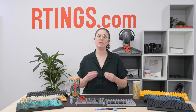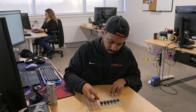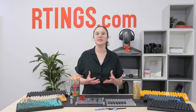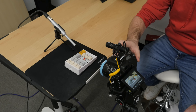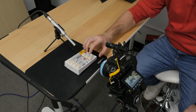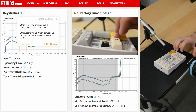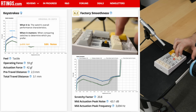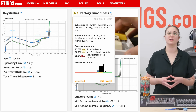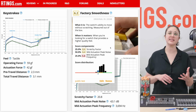Audible noise plays a huge part in how people experience scratchiness, and removing that factor from our test wouldn't capture the full experience. So we developed an audio component as part of this test. In a nutshell, we record the switch as it's pressed midway using a camera with a mic mounted on top. This video ends up in the review so you can see and hear the switch for yourself. On the backend, we run a plot spectrum job on the audio data to find the high frequency and loud noises that indicate scratchiness. Combining these results with our scratchy factor, we end up with a factory smoothness score — a more holistic picture including the feel of the press and the sound.